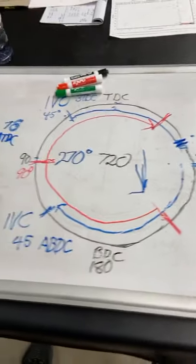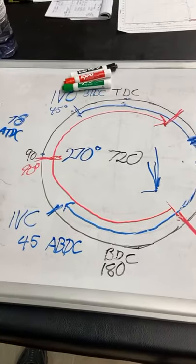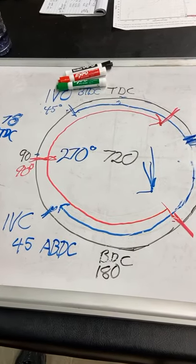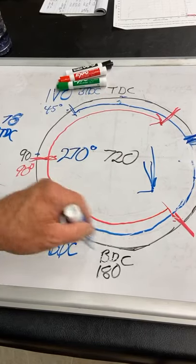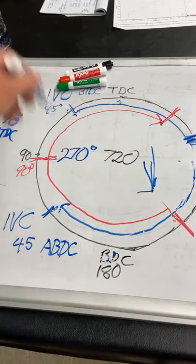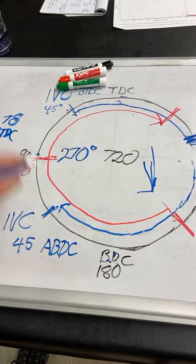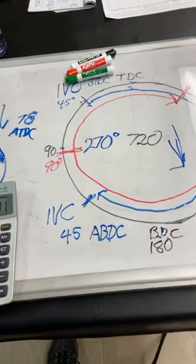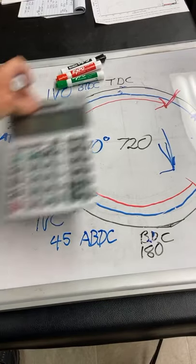And then the rest of the story down here at the bottom, which is really complicated, y'all. I didn't think about how to explain it, so as you can see, I'm fumbling a little bit. But hey, that's my own problem. Anyway, when the piston goes to the bottom and stops at bottom dead center, the air is still coming in. And when it stops coming in at whatever RPM you're at, you want the intake valve to shut. So we have to pick out what number that is, and it's only good for one RPM range.